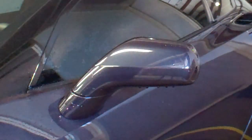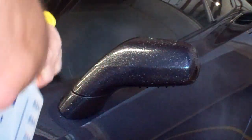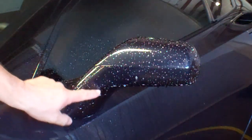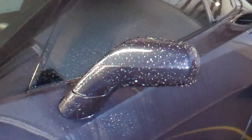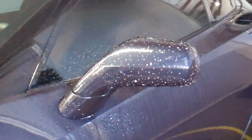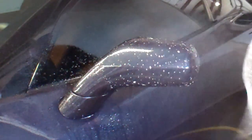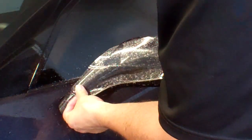I'm going to put the water and alcohol down and switch back to my slip solution to wet this portion of the mirror, because this is where I'm going to start with my film and where I want the film to sort of tack. When I pull my pattern off of the liner or backing, I immediately pull it off and wet both sides — the adhesive side and the clean side. I've already put some alcohol here, so that's going to be my tack point.